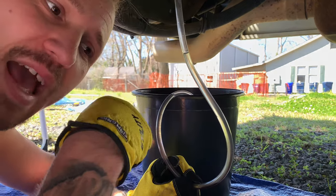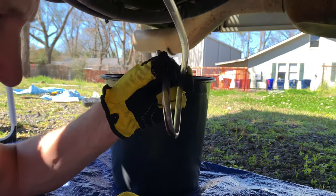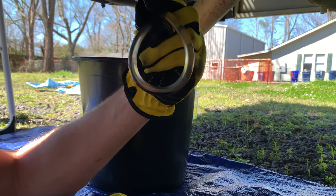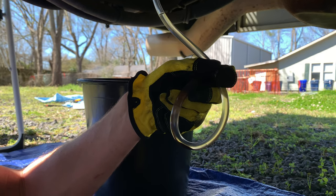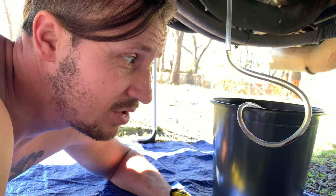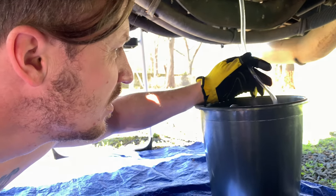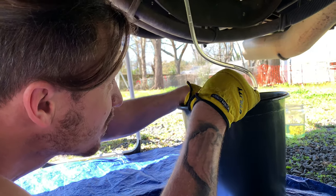We hooked a hose up to the fuel water separator so that when you take the fuel filter cap off, it creates a vacuum and allows fuel to come down the hose instead of dumping all over the place. There's all this sediment collected in the hose — that's the algae that built up and clogged our filter. That's what happens when your diesel sits too long. I learned from the international dealer that when they lowered the sulfur content in fuel, it caused this algae buildup. We admittedly committed the cardinal sin for diesels by just letting it sit all winter, so we are to blame a bit.